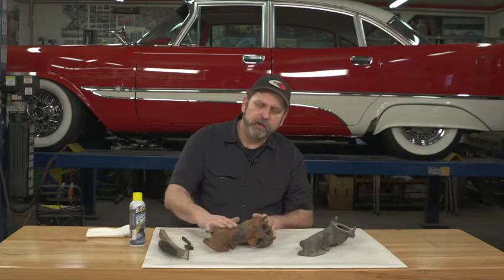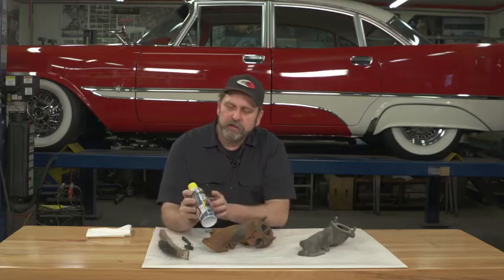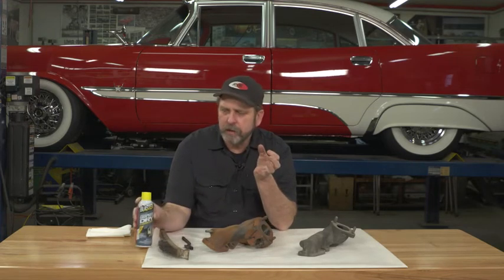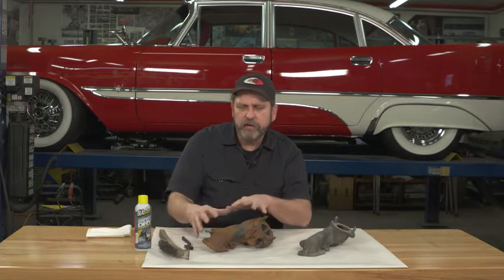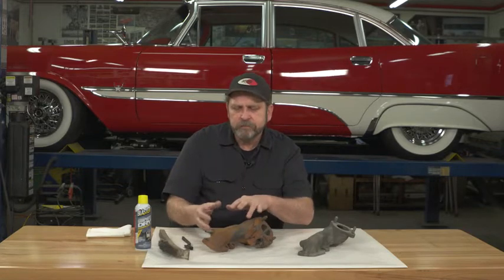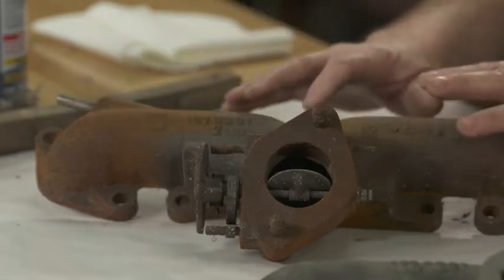What I've found is a good alternative to a lot of the aftermarket coatings is just to hit them with some graphite dry lubricant. It's primarily a graphite powder in a suspension, and as it dries, it dries kind of like a gray, semi-metallic look. And as it wears off, it doesn't peel or chip — it just wears off, and you can reapply and put another coat on to freshen up your exhaust manifolds at any time.